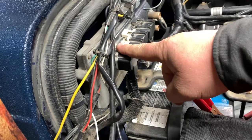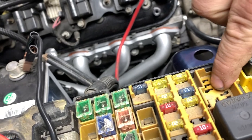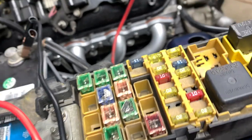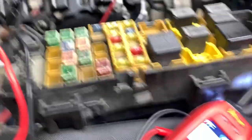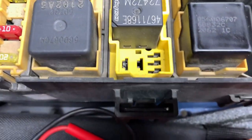The control wire — the PCM gives a ground through this gray plug right here, that's terminal number three, which connects to that bottom one right there. I'll go through that, but what we want to do right now is that with the ignition off, only one terminal is going to have power.